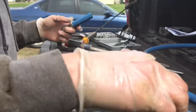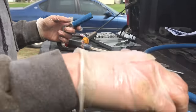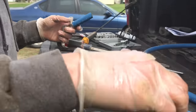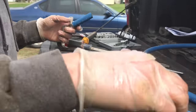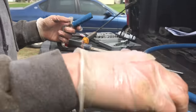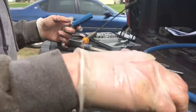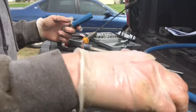Now I'm routing my tank hose. It's on there pretty tight. What I did is routed it over — it's getting hard to see but there's a little indent in the tank, a little slot to route it through, and it goes on down and then I'm going to plug it into the sump right here. I just need to cut off what I need and put it through. Now obviously I'm going to clean up the lines, tighten them up, and zip tie everything.